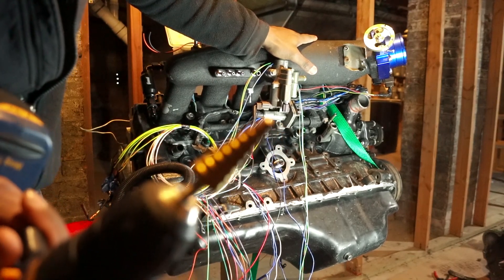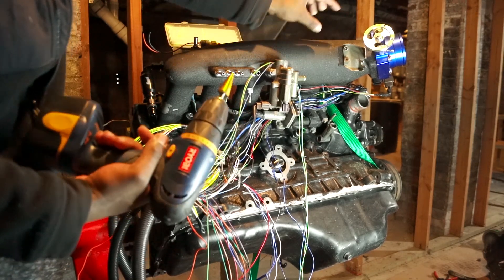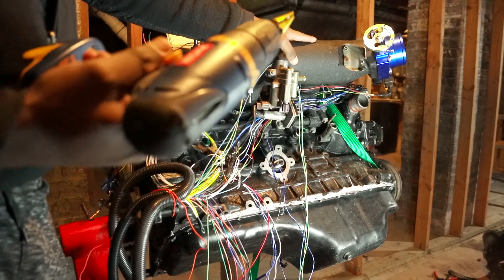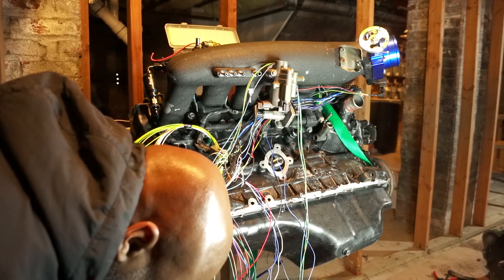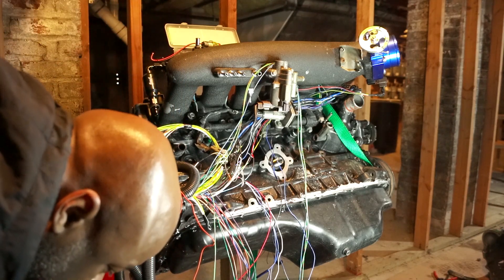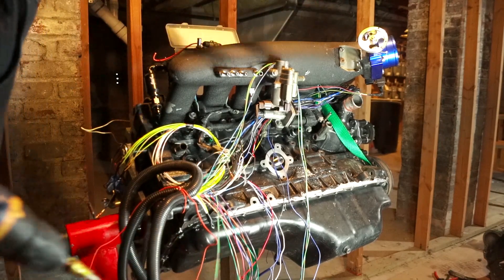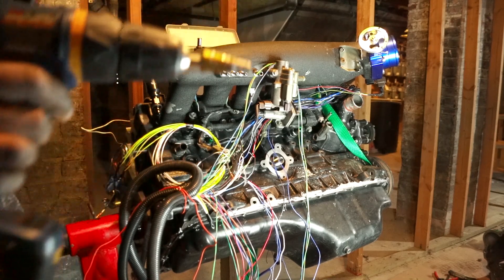This area has already been coated in a heavy oil. Normally you would do this before you put on the intake manifold, because you really don't want aluminum particles floating around the engine. That's why I coated it in oil — to catch a lot of them — and I'll go really slow. We'll size that up and that is a no-go.